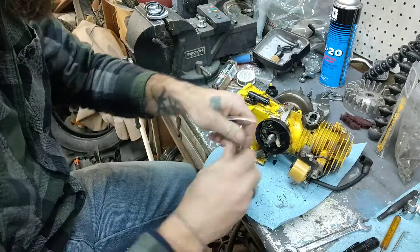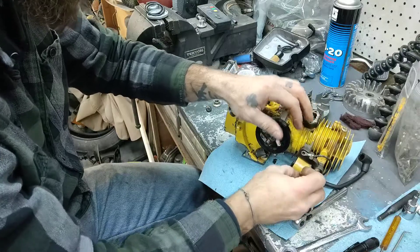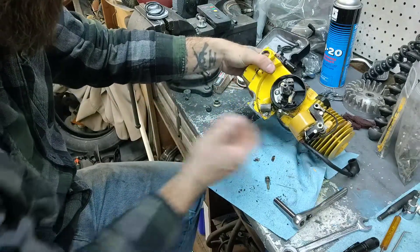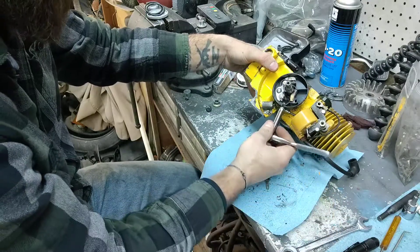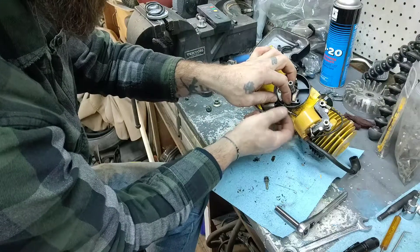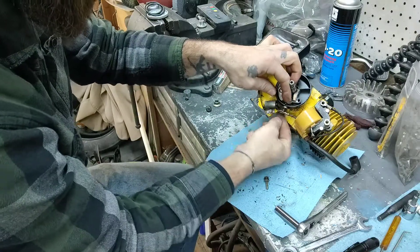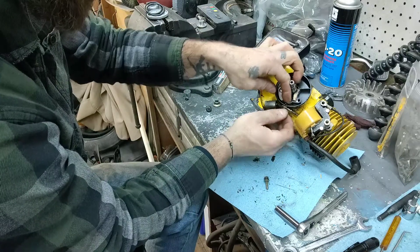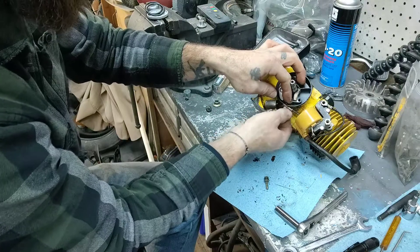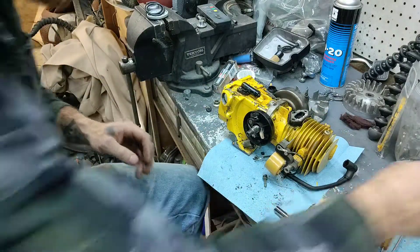Let's go ahead and take this coil off. Don't want to lose our washers here. That was the ground. Go ahead and disconnect it from the body here. All I'm going to do here is take the wires off the coil. I'm going to leave the condenser on — that can stay attached. I just want to separate the ground wire, or the sending wire, that comes from the points to the coil. I already have a bag set up for the points.